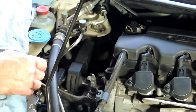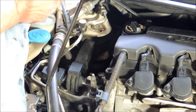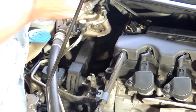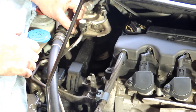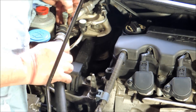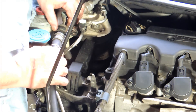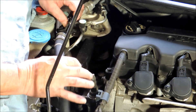Next, take your 10 mil socket and ratchet. There's an air conditioning line here, and it's probably best if you take this bolt off — it holds a bracket for the air conditioning line — because you're going to want to move this line a little bit to get out of the nut down here. So this comes out. On this one, don't put the bolt back in; just put it in a location close by. And there you go — we've got enough room to move.